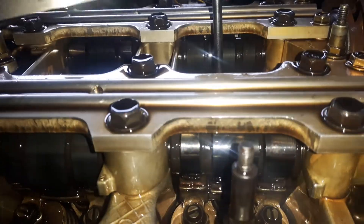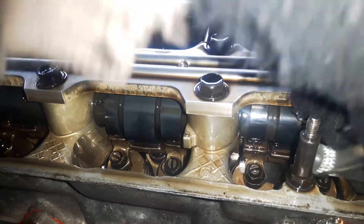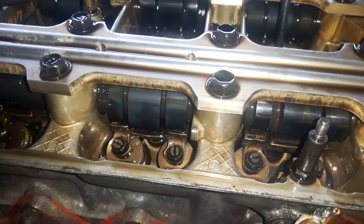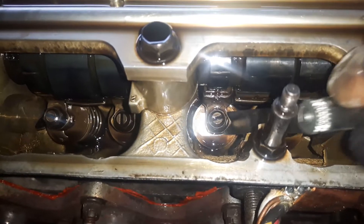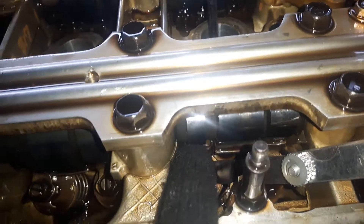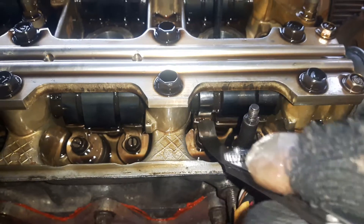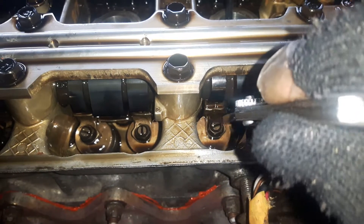This is at 0.008 — you get the gap right there; there should be a slight drag. It's very difficult to get in. This is way too loose — there should be some drag. You can also measure this gap right there. It's way too loose; once you tighten this, the slope comes up.